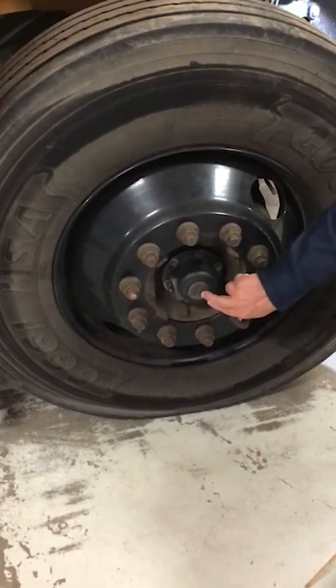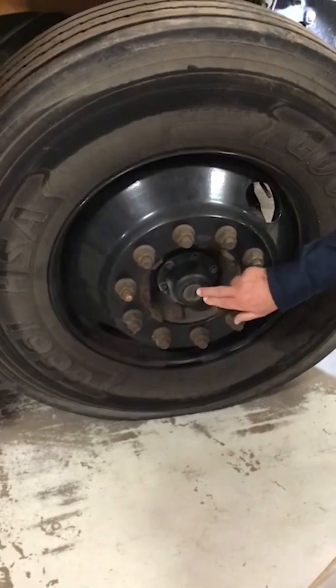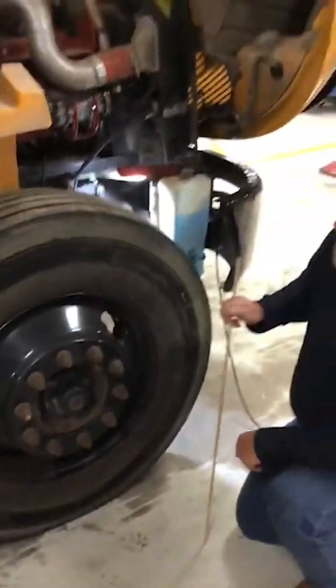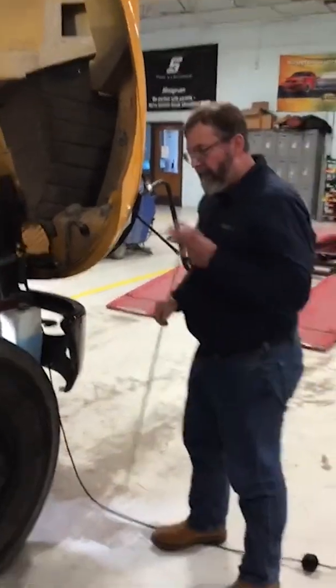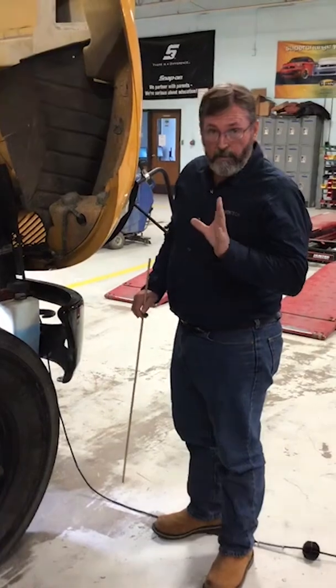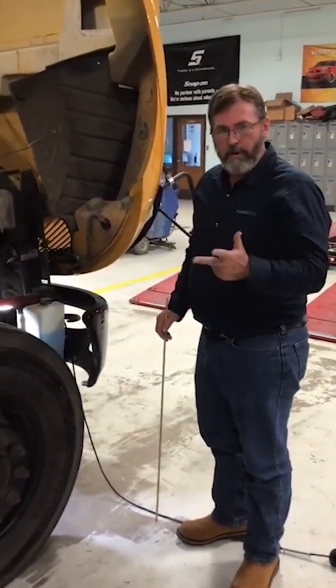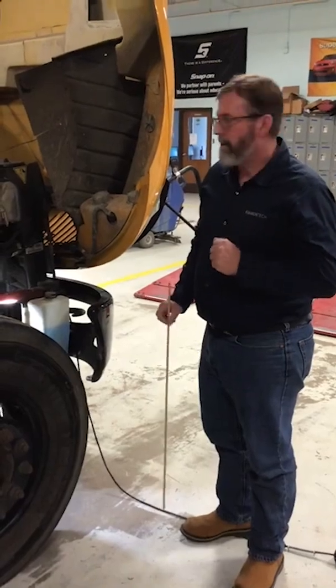And also, if we had an inspection plate, we would look to make sure the oil level is adequate on that. Okay, moving on from there, we will go to our engine, and the three main things we're going to be looking for, other than the fluid levels, are the alternator, the water pump, and the power steering pump, since this is not an air brakes bus.